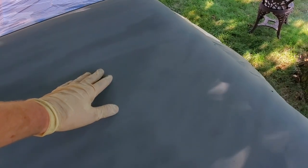I mean, it dries pretty fast already, but obviously those dark spots are still a little wet. I'm just gonna let it dry and then sand it down with some like 320, nah, that might be a little too heavy. Maybe like 600, just to smooth it out a little bit, because there is a little bit of dried overspray. You can kind of feel some bumps here and there. So wait for that to dry, and then I'll do what I just told you I was gonna do.